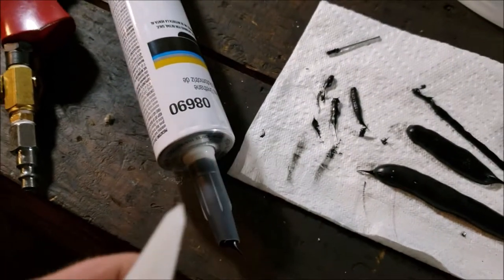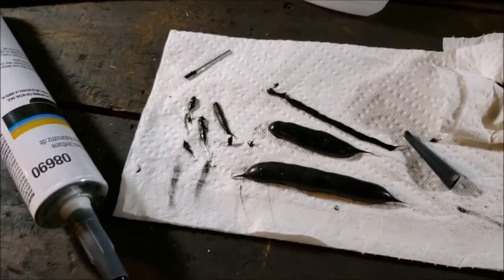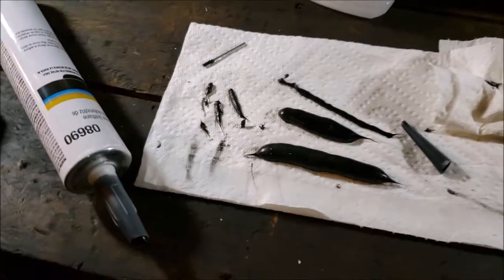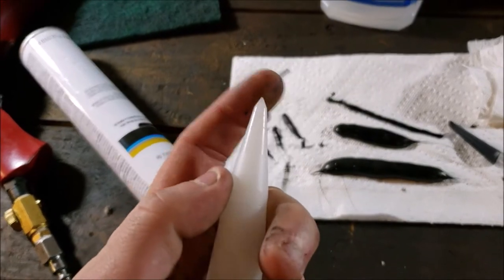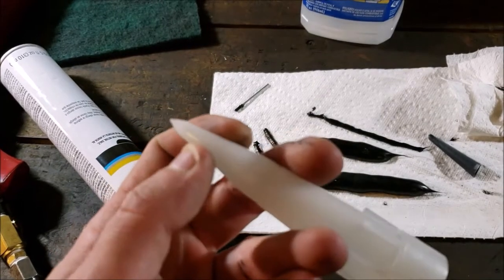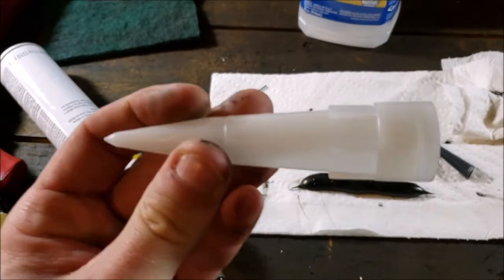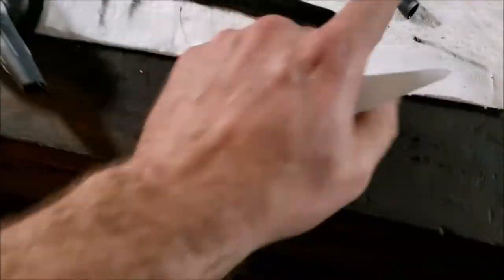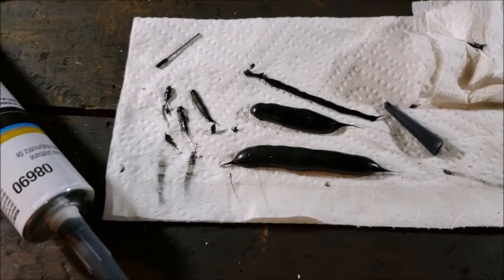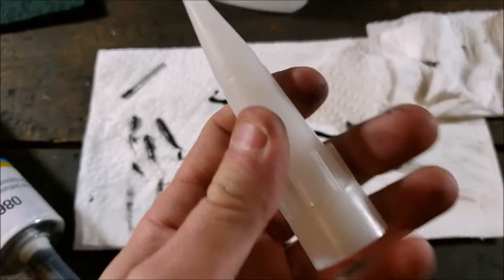So now I'm going to put my pinch weld primer on. They say give it 10 minutes, but I got humidity, so I'm going to give it a little while, 20, 30 minutes, whatever, while I prep. I'm going to cut this. I'm going to use a drywall razor blade, or I may even just die grind it and then blow the dust out and clean it with mineral spirits. Let's see how that goes, because this is pretty tough. I'm sure you've snipped these off. I just snipped that end off with a pair of dikes, but this is extra hard. It's premium.